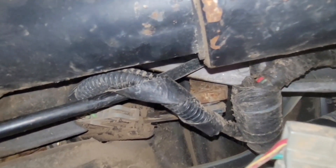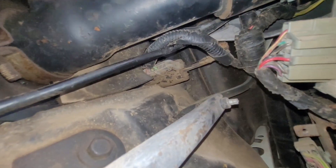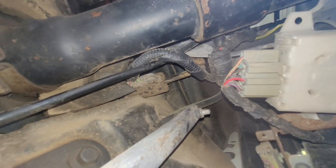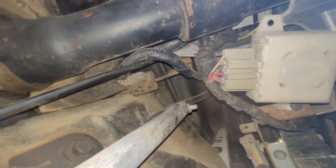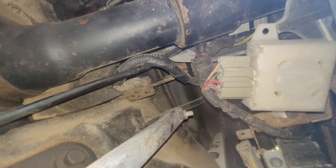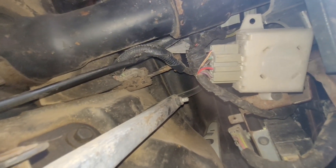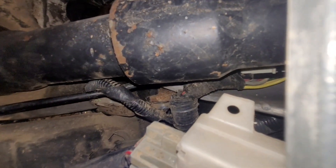The bushing on there actually is looking okay, which is not a good sign. You can see there's a little bit of play in the bushing but it's not the worst - there's probably a half inch of play on the pedal side. And there is some dead space on the clutch master before it starts working. Hopefully our clutch isn't worn - I mean there's a fair amount of play in there.